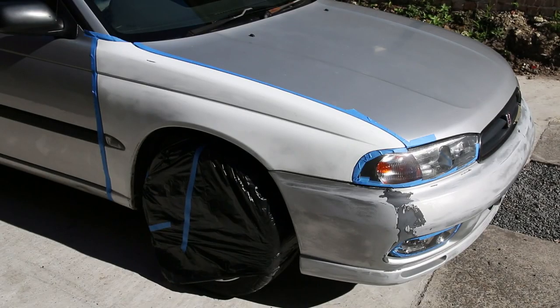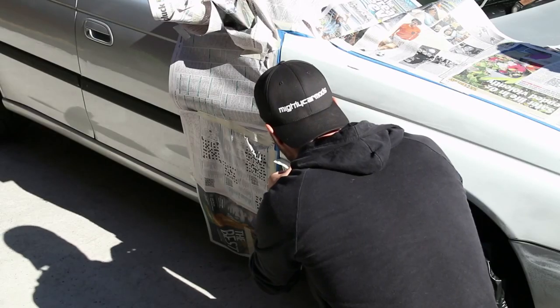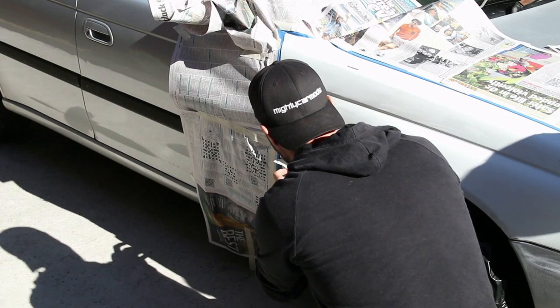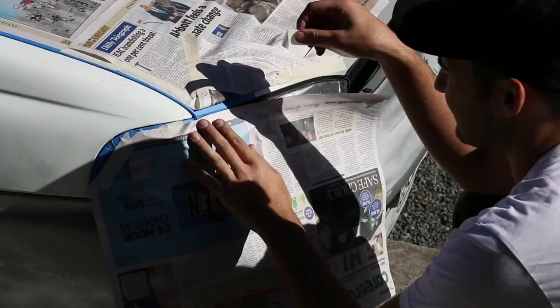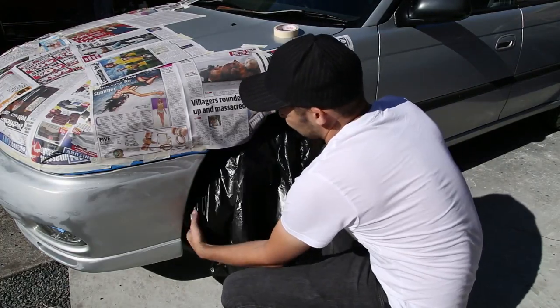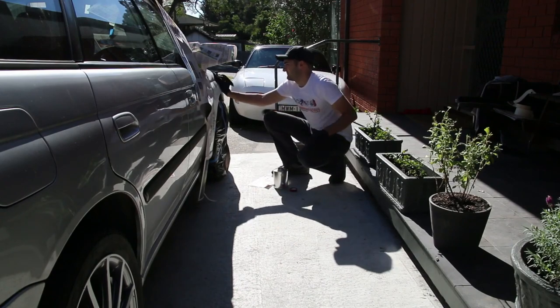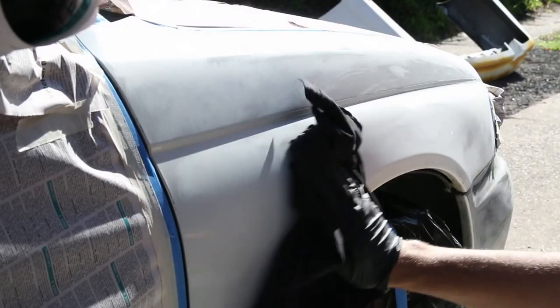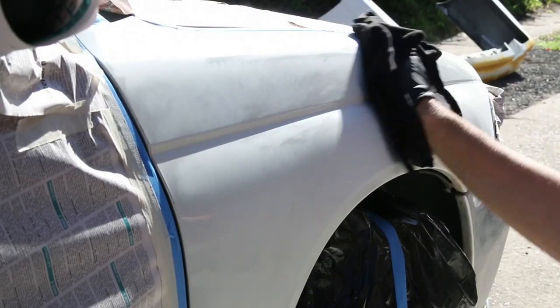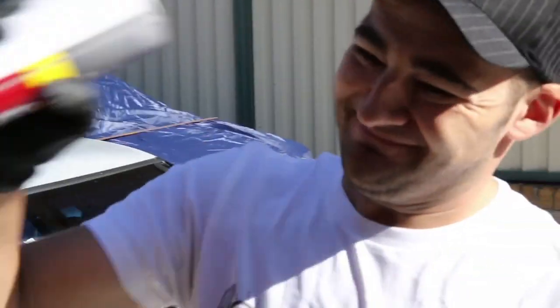If you're masking up, first run masking tape along the edges of the panel. It's a good idea to cover your wheels too — garbage bags make this really quick and easy. We're using newspaper, but you can use plastic drop sheets, which have the added bonus of being waterproof. If your panel is brand new or has no imperfections, you won't need much preparation at all. Just clean it down well before you paint. You've got to shake up the cans really well or they won't spray evenly — give them a good shake for at least a minute before you use them for the first time.